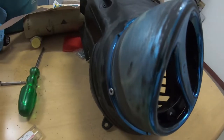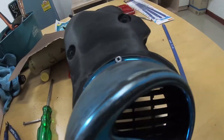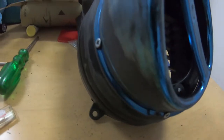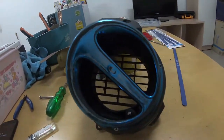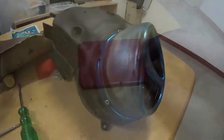So far I've mainly been using 100 and 180 grit sandpaper just to get a really rough surface so that when I apply the filler it's got something really nice to bite onto. You can see there are a few gaps in there, but that's all going to be filled once the body filler goes on. Let's make a start on getting some body filler on the shroud.